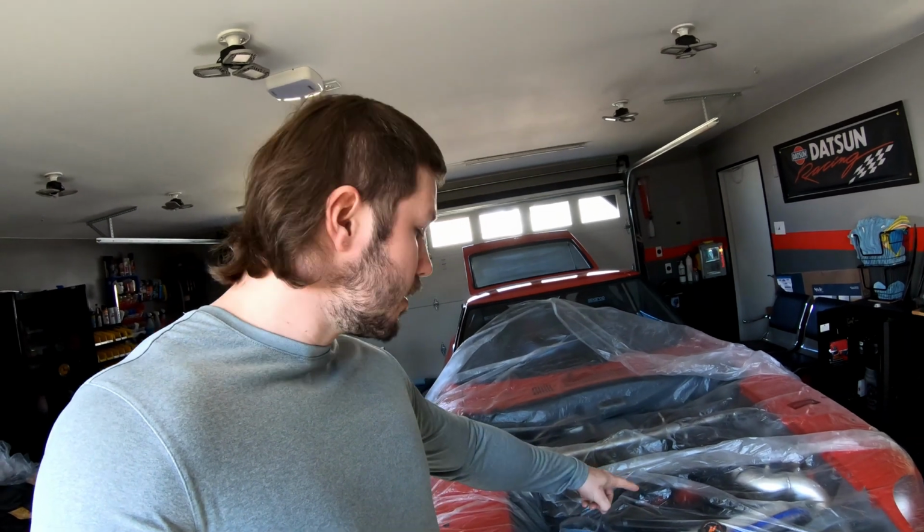So it was like hit or miss when I would find it, and it was really odd when I was trying to locate it, because now that I know where it's at, what was happening was it's leaking, and I'll bring you in to a closer view, but it was leaking from the top of this radiator neck part on the 1J.